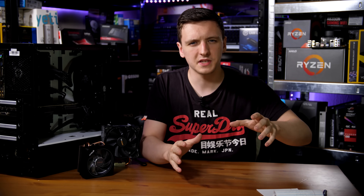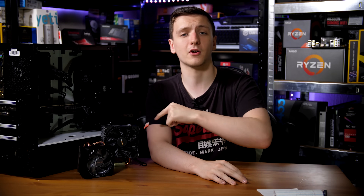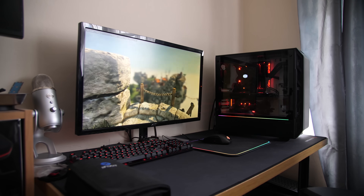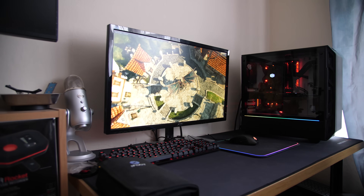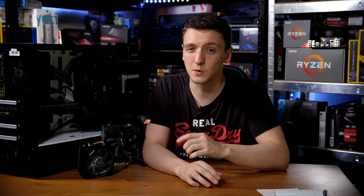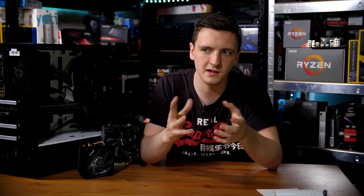If you have a little bit more money in your build and you've already specced out your CPU and GPU components and have a bit of extra cash, go grab an air cooler - it'll be a little quieter, perform a little better, and depending on which one you get, you might have a little more room to overclock. If you're planning on overclocking your CPU a good amount, an AIO cooler is what I would recommend. There is an asterisk here - high-end air heatsinks like the Noctua NH-D15 or Be Quiet Dark Rock coolers will perform very similarly to large AIO coolers and can potentially be cheaper, though they are heavy, large, and put more strain on your motherboard.